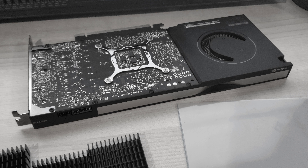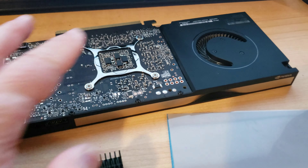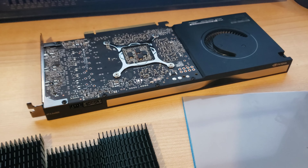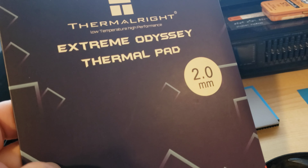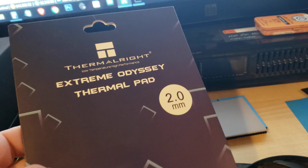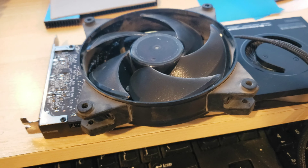I've got some heat sinks and a big chunk of thermal pad — two millimeter. I'd really like three millimeter, but this is what I have on hand. If you're going to do this, I'd suggest three millimeter. The part I'm worried about with only the two millimeter pads is all those little solder points on the back — I don't want to short anything out by putting a metal heat sink on a GPU that doesn't have a backplate.